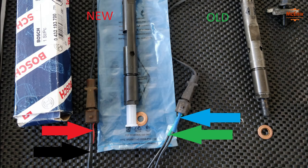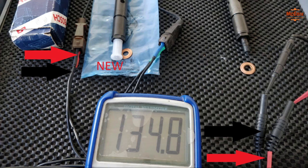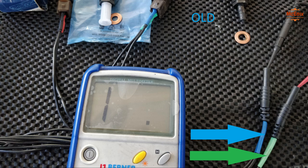To make things a little easier I took both injectors, new and old, and compared the values for reference, but you should check this in place first. I wired the new injector with black and red wires and the old injector with blue and green wires. The readings were: on the new one it gives 134.8 ohms, and for the old one the readings were none, meaning that we have a dead lift sensor.